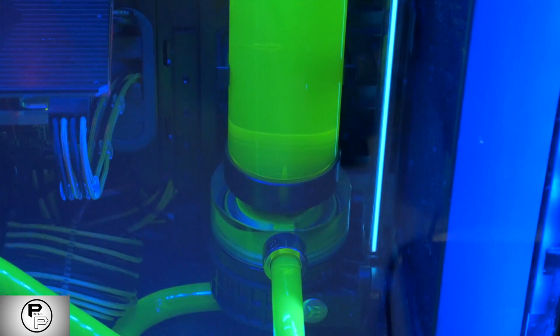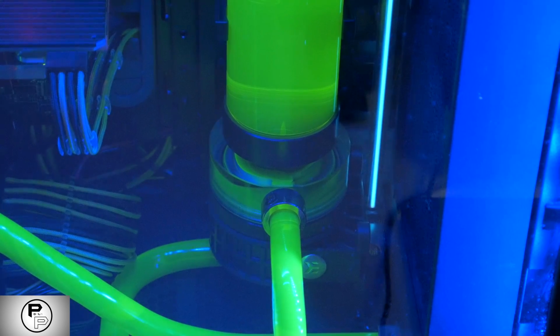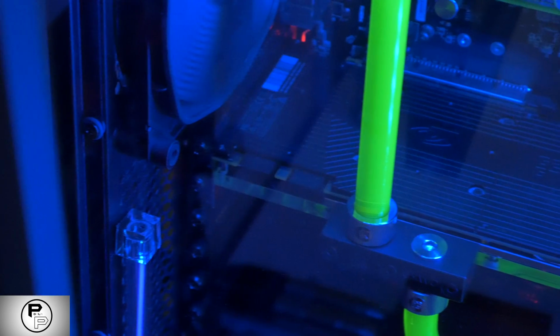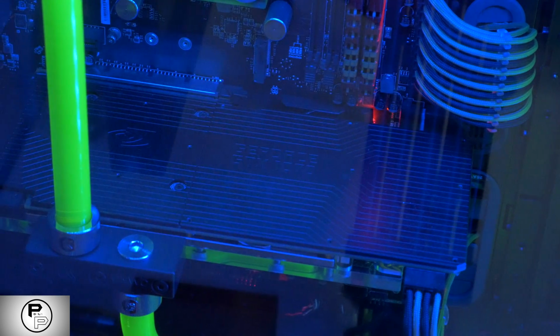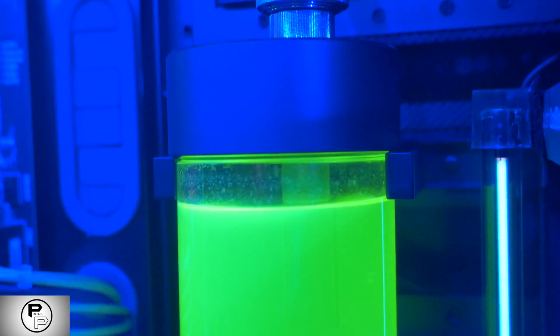You may find during this step that the tubing makes too sharp a turn, that it kinks, for soft tubing. This is bad for your water flow, so you need to return to the planning stage and see if there's a way to make the bend without a kink. Sometimes giving yourself some extra tubing solves the problem, but other times you'll need to connect your components in a different order. To disconnect the tubing from your fittings, you may need to slice it off with a razor blade where the two connect. Pulling them off is often very hard to do.